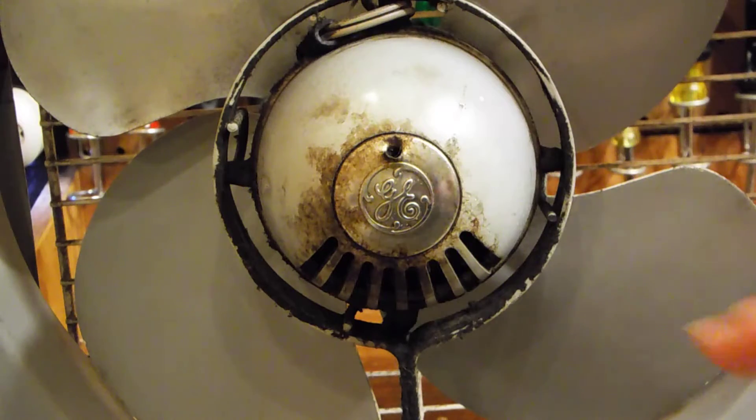At the back of the motor, behind this plate, the shaft comes out of the single bearing and there's a c-clip that holds it on. There's also a large well which is filled with foam, and that's what would have been filled with oil.